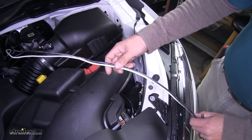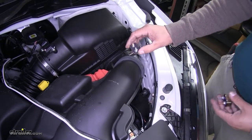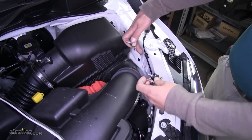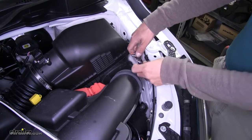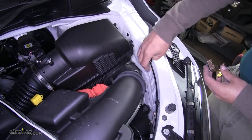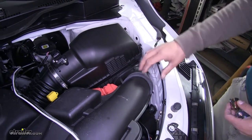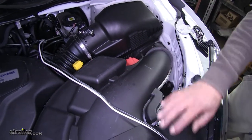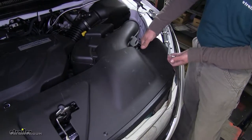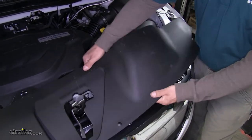Now that we have our wire stripped back, we're going to need to find a spot to mount our breakers — one for the power going back to the seven-way and one for the power going to the brake controller. Right to the outer edge by our driver's side headlight right here against the frame rail is going to be a good spot. To make it easier to get access, we're going to be removing this section of the air box as well as the covering over the radiator. Lift up and release those clips and work our way over to the other side releasing the clips, then pull it off and set it aside.